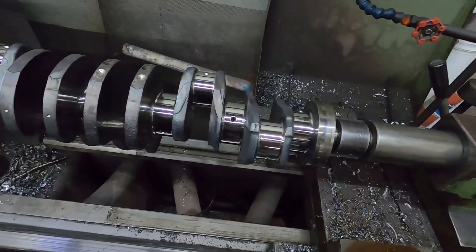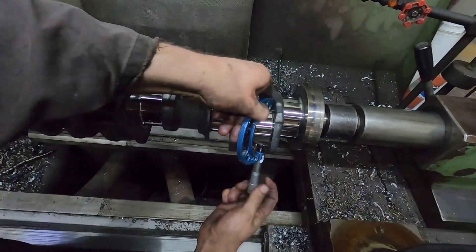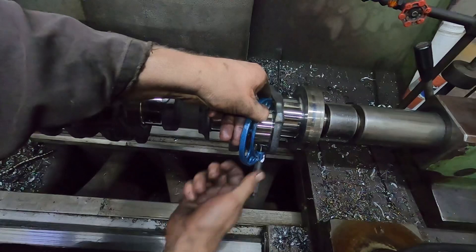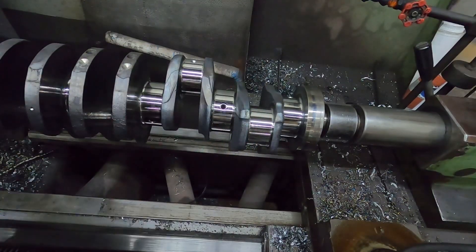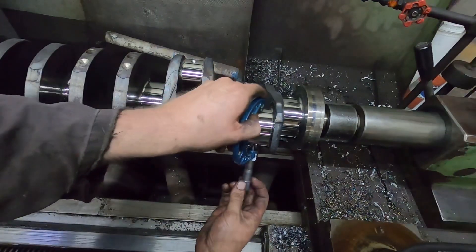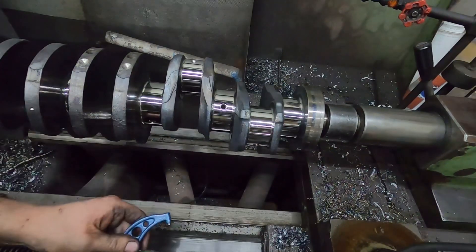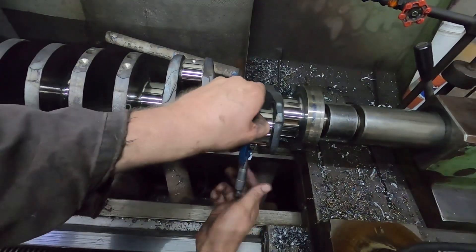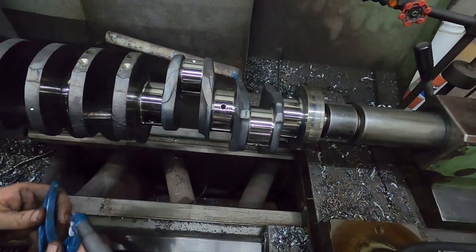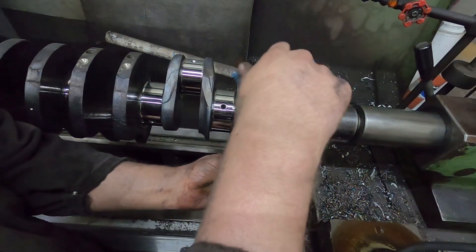You really should wear a mask when you're doing that. Being that it's late, I don't feel like getting all suited up for one crankshaft — I usually do a bunch of crankshafts at once. You want to measure in a couple spots on it just to make sure that everything is round.